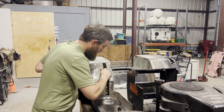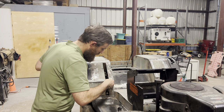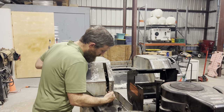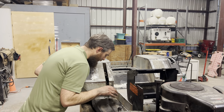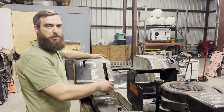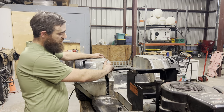It's reverse, neutral, first, second, third, fourth, fifth, sixth. Pretty fast for the last ones. But that's sixth gear, and it's not touching anything. It would be nice to have a longer handle. All right, well, we have freedom to move through all of our gears. That's exciting. Let's get a 5.5 inch extension cut out, and then we'll pull the body off and weld that in place.